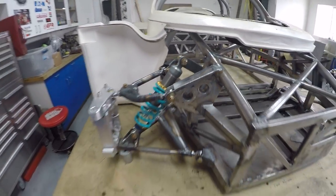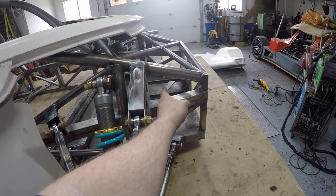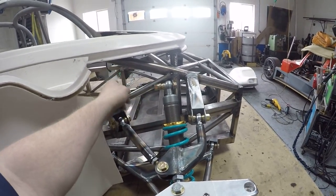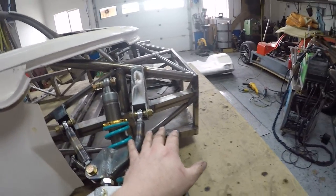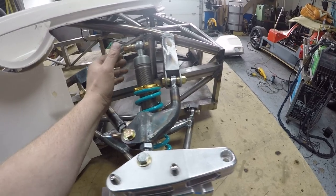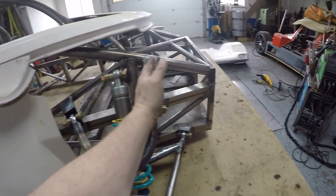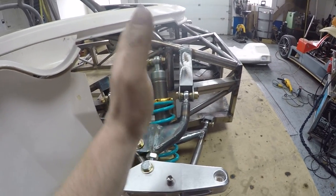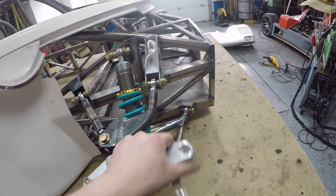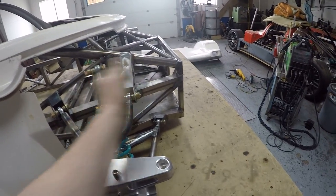Nothing's ever easy or straightforward, and I've complicated things by putting the steering rack out front ahead of everything, whereas normally the original car had the steering rack at the rear. I don't like putting my feet underneath the steering rack, but this makes the front end very busy. The original car had the rack at the back with the shock absorber sitting nicely and the front wishbone point going right to the front. Now I've got to fit the wishbone point, get the shock absorber reasonably vertical, and also ensure the steering rack doesn't hit anything on full lock in both directions - all within about eight inches of chassis.